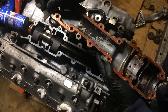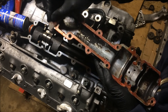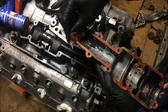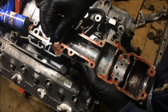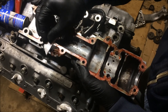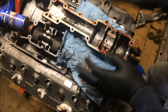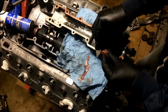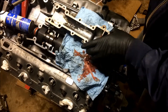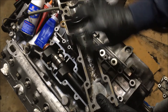I have a brand new razor and I'm just going to try and get the edge of it here, and then gently peel all of that gasket maker up. If you're lucky it will all come up in one piece — if not, it's not a big deal, but it makes it a little bit easier. I got all that gasket material off there now, and as you can see, it came off really easy.